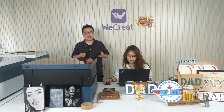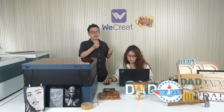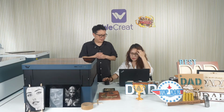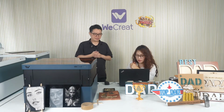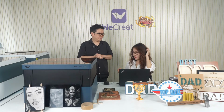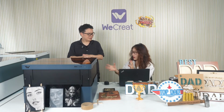When you're pulling out the cable, please use your finger to open the latch connecting the ribbon cable, and do so very gently. We also shot a how-to video on our YouTube account. I made that video actually. For me, it's kind of easy. It only takes me about 3 to 5 minutes to swap the laser head, but you have to do it gently.